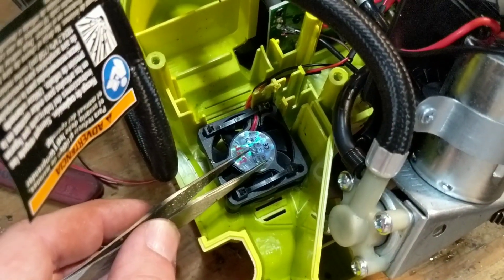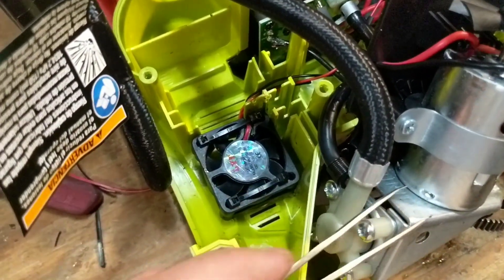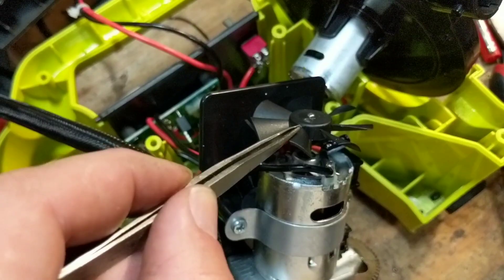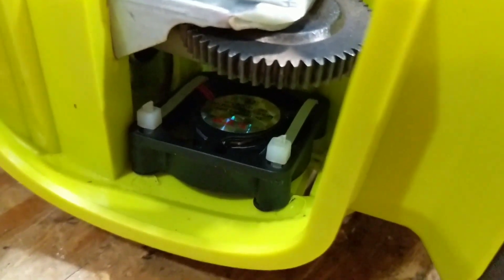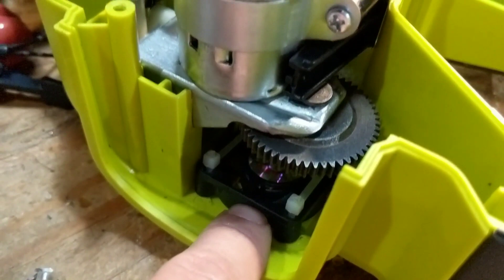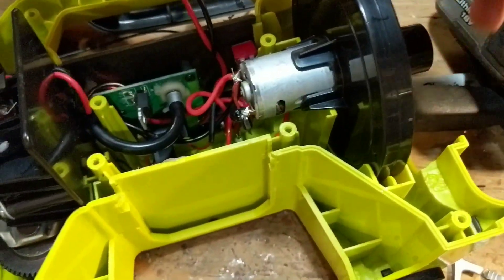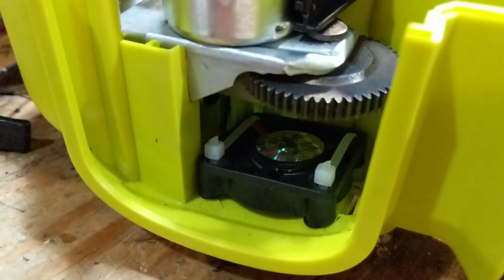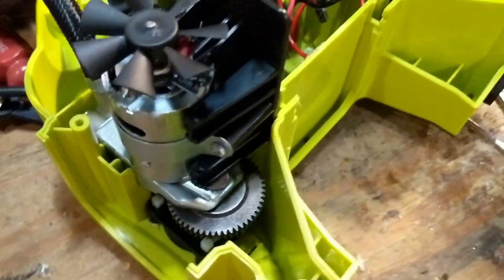The sticker side blows in, so it's going to pull in air to cool down the motor or the compressor sitting right in front of it, without the compressor running — otherwise the compressor relies on its own fan. There wasn't enough room for two fans side by side, so I put one here and moved the other one over here. They're pushing air toward the compressor — in here and then to the left there are vents next to the inflator, so that should help it cool down. There just wasn't enough clearance; if you get one 18-volt or 24-volt fan it should clear, but I had two 12-volt fans so I put those in series and that's what I've got.